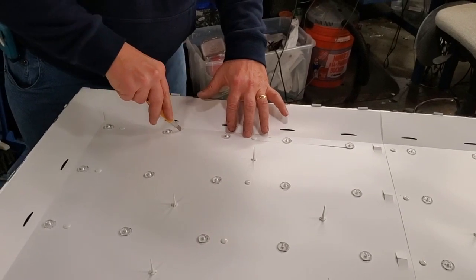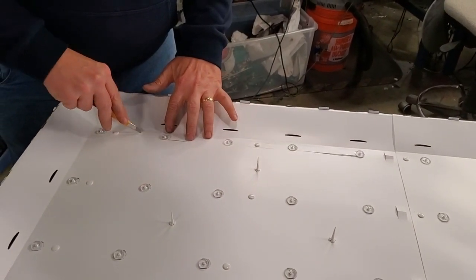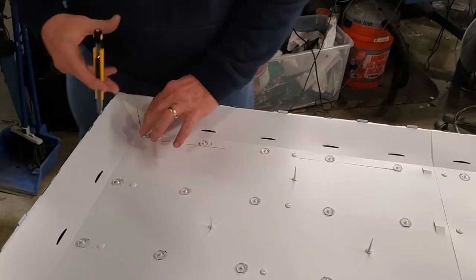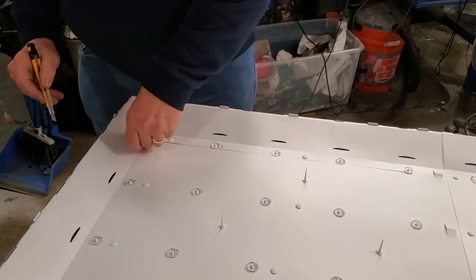While we are replacing these LED strips, we are going to cut out the paper that is on top of them. We have found that this is an easier process and better for saving the reflector sheet for the rest of the TV's chassis.